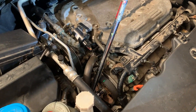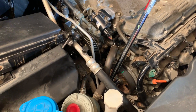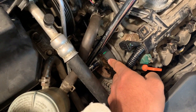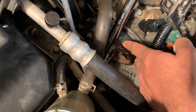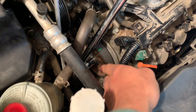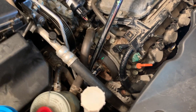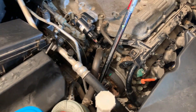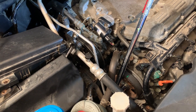All right, back again this evening. I tried to have the mark one tooth over this way, but just that one tooth moving over loosened up the slack so much that it was almost too loose. Where I had it before was perfect — that's why the factory manual wants you to take out the idler pulley and then put it back.